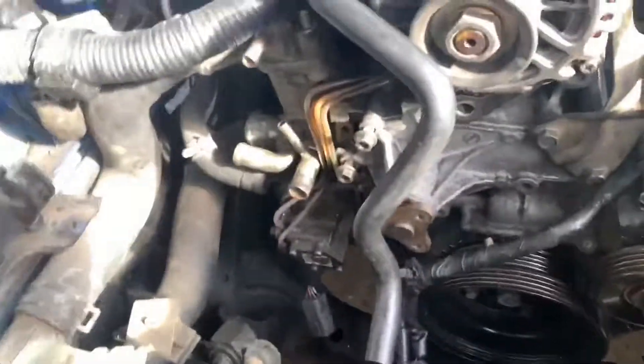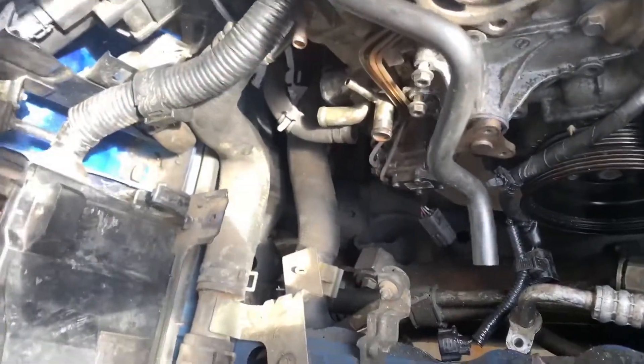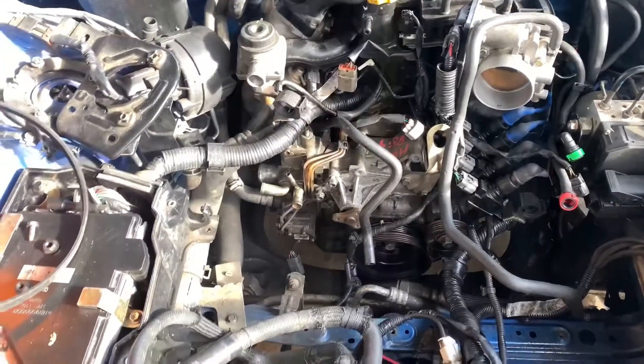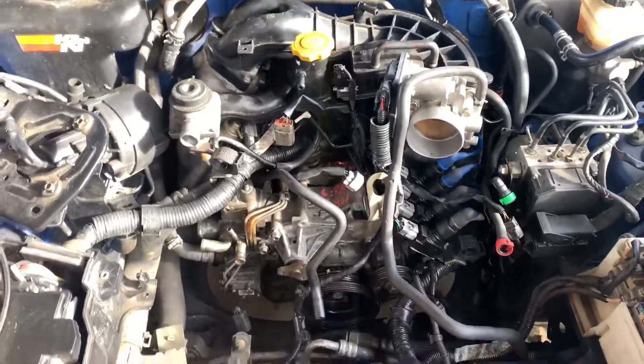I realized I don't have the fuel lines hooked up, which is kind of dumb on my part, but live and learn. I got the water pump pulley off so I could get the alternator mount and bracket off, and now I can get the alternator out. I'm probably going to have to take off the intake — I was hoping I could just sneak back there and get it, but that doesn't look like an option. Let's start wrenching.